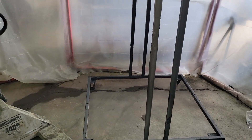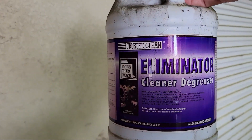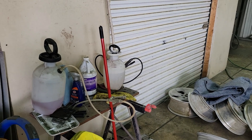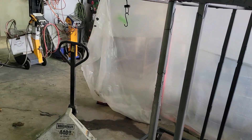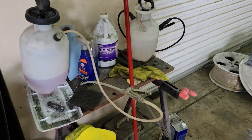What we'll do is hang the parts and apply a degreaser — we've tried a bunch of different ones and they all work pretty well. You dilute it out a little bit and it degreases the part, cleaning all the oils off. We spray that on, and if we have to, we've got green Scotch-Brite pads and we'll actually scrub the parts if they're super filthy. Some of the gas tanks we do — like a gas hauler tank where the guy sprays anti-splatter on it — we have to scrub those really good. Then we get our hot pressure washer, crank the heat, and rinse them off on the rack.